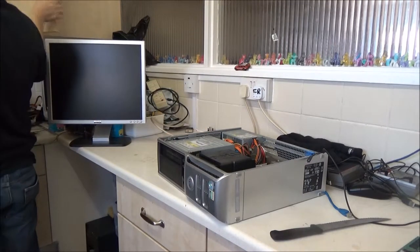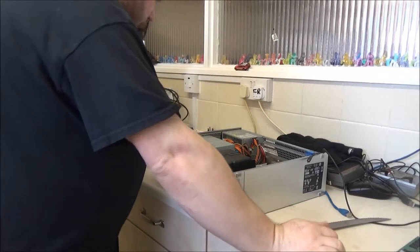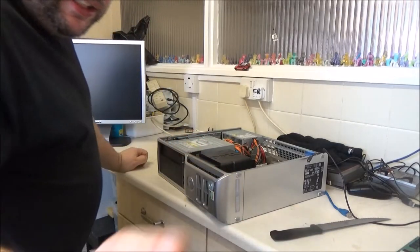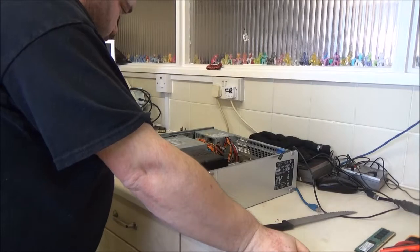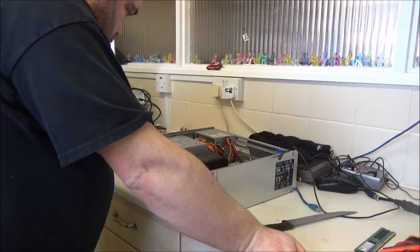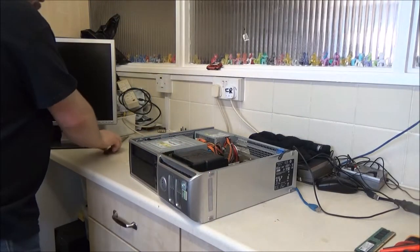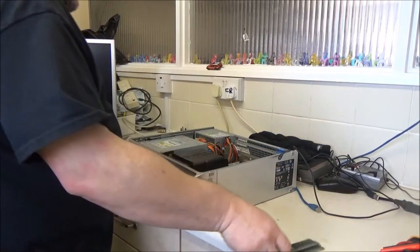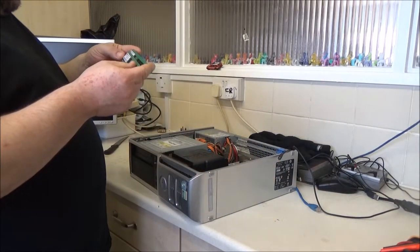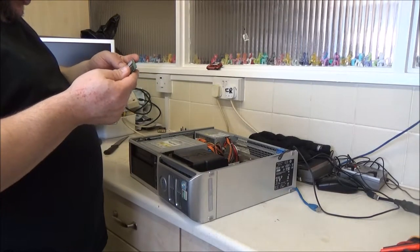These sorts of Dells were never really designed to be upgraded by that much - you can upgrade the RAM. There are four DIMM slots in here: two with white clips, two with black clips - I presume dual channel, that's usually the reason they do that. So you'd put a matching rated pair in each channel. This one is DDR2 4200, so it's not bad speed-wise.